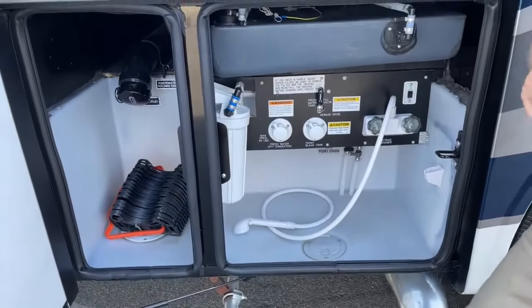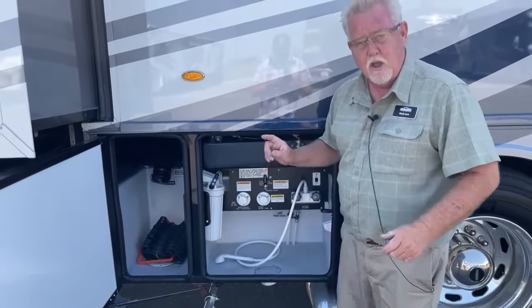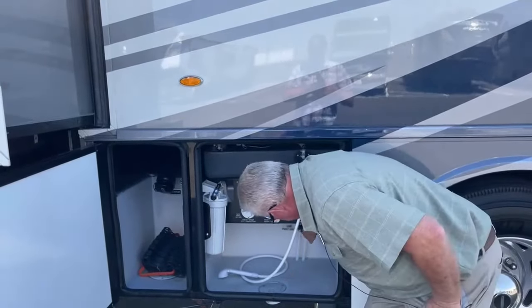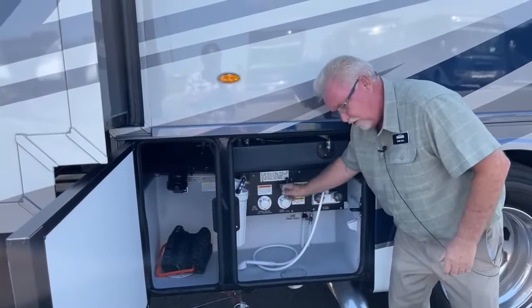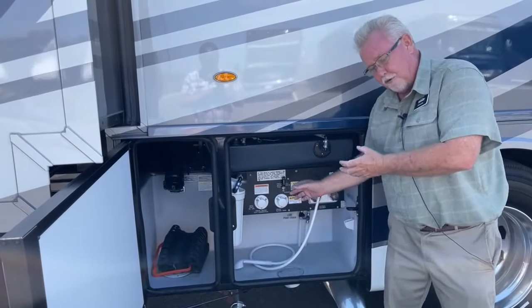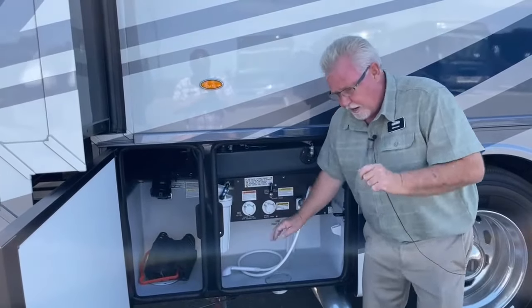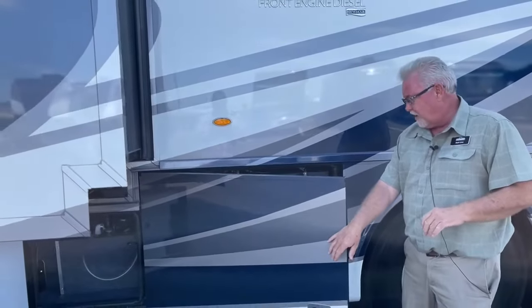One other thing I'm going to talk about, and we'll get into this more next week with Bill. One of the problems or questions I get, you know, we're camping the first night and we just can't get water pressure. It's just kind of spitting out. What's happened 9 times out of 10 is one of these valves is in the wrong position. It's not allowing it to build up pressure from your 12-volt pump. You know, there's a couple of low point drains here. If one of those are open, you're just going to spit that water out all the time. But if you have this in the city water fill position to where you're putting water into your tank from a hose and you don't switch it, when you turn on that pump, you're just pumping that pressure out that same hose. You have to close that valve. So if that happens to you, get out and check your valve positions, because 9 times out of 10, that'll take care of it.